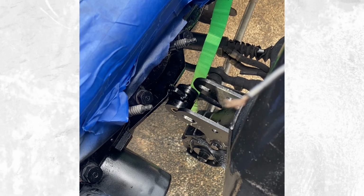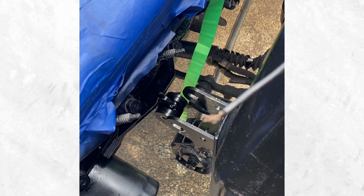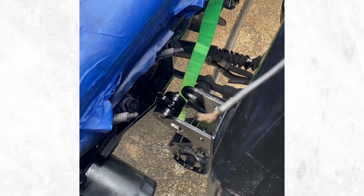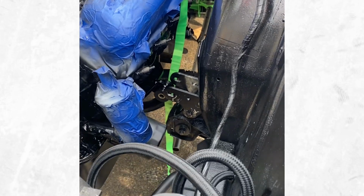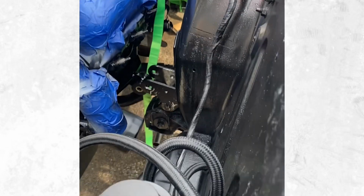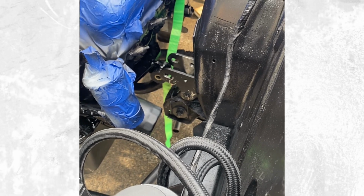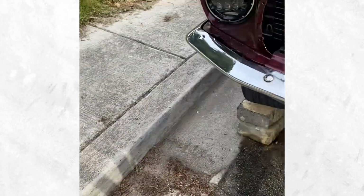To be honest, I'm not entirely sure. I just know that '67s are weird when I was looking around online for doing these motor mounts, and everybody seems to have to get adjustable ones, or factory replacement ones are the best option really, but it seems like you kind of got to be a little creative if you do use some aftermarket ones, unless they're like the Ron Morrison ones. Apparently those ones are awesome because they have a ton of adjustability. But again, I picked these up used, and for the price, I don't remember what I paid. You just can't beat it. So I think if I can just bring the motor back up a little bit, jack it up a little bit more, and get it in, I'm going to obviously slide in the bolt for the driver's side, then see where that lands me on the passenger side.